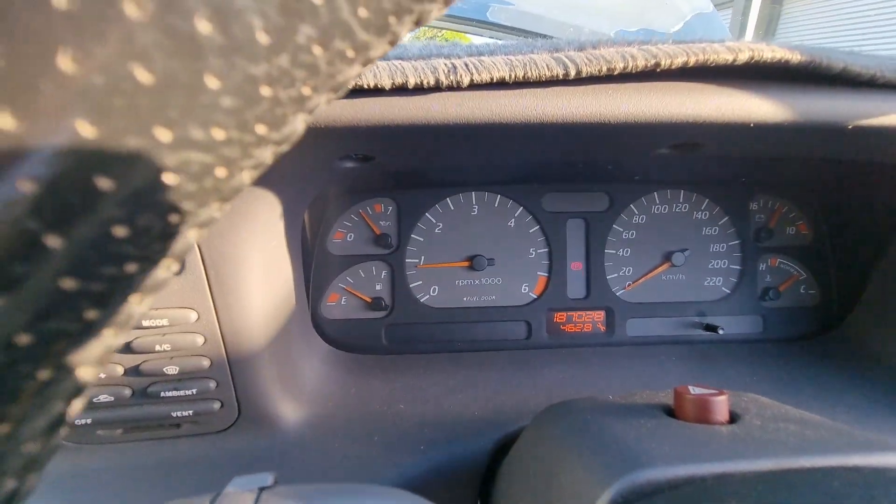That's basically the method of setting your base timing. It's probably a little bit more difficult with an upgraded cam — it doesn't really want to idle nicely when it locks itself in timing mode. It was actually idling a hell of a lot lower than what it's tuned for, hunting around 600 RPM, which is a little too low. On a stock or very mild cam it'll run a lot smoother and you'll be able to set your timing without too much issue. Once you're done, just pull your connector out and start it up — should idle as per normal.